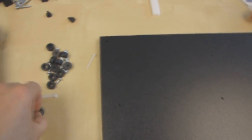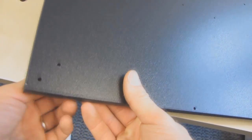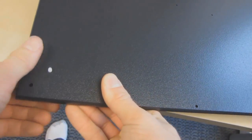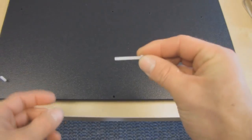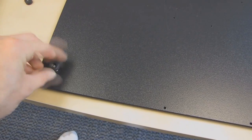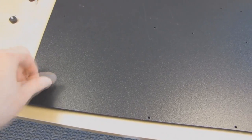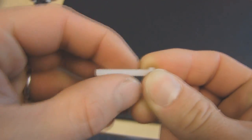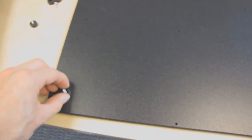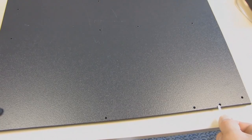the rubber standoff. Now, for a couple of the holes, so invariably this one up here, which is going to be the top of where your motherboard is mounted, and all the way through, there we go. And then sometimes this one, and sometimes this one, you're going to put these 2 nylon screws, and then you're going to hand thread down a rubber standoff. And this is to hold the board in place, because the threads on these guys, see the threads on here? Will keep the board from slipping off. Okay, so just hand tight on there. So you put it here for MATX, here for ATX, and here for XL and HPTX.